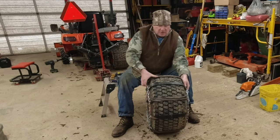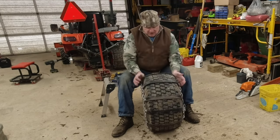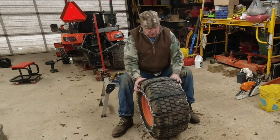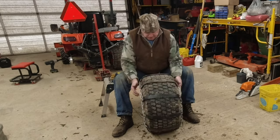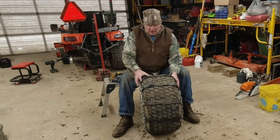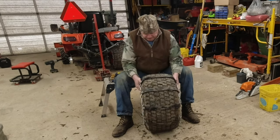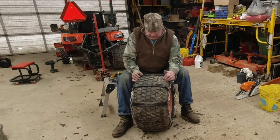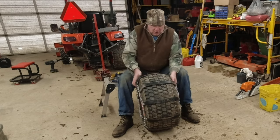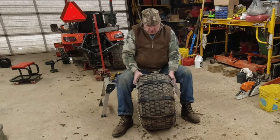I'm going to take them up to 25 psi to make the tire balloon a little, just to take up any slack. I'm going to space these traction devices before I put it back on, and I'll air up the tire after I put it on. I think it's going to be a heck of a good setup.